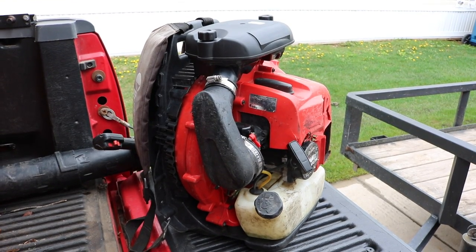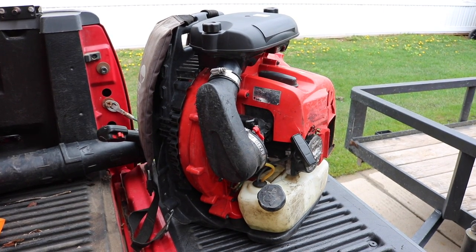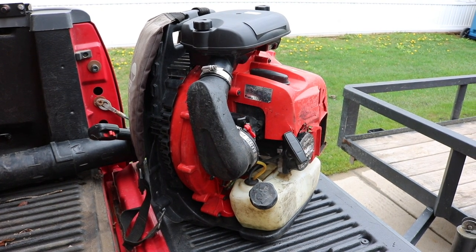That's how you change the air filter on top, the spark plug in the middle, and the fuel filter on the bottom. Do these at least annually and you'll start getting a lot of the power back that's been robbed from your blowers. It's about $25 in parts.